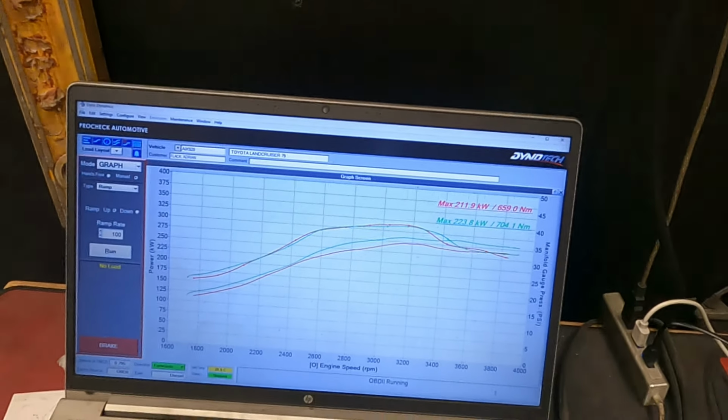I was going to do some adjusting of the fueling and everything else, and the map correlation as well. So we change around with all that sort of stuff, have a bit more of a play, load another file in. I'll get a good difference between the two maps, otherwise there's no point having two maps if they're only a couple of kilos different. So we'll make it a good change between the two, try and make it a good tow slash economy tune in map one, and map two will have the power tune.